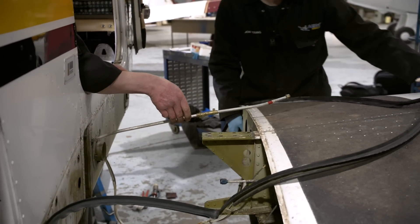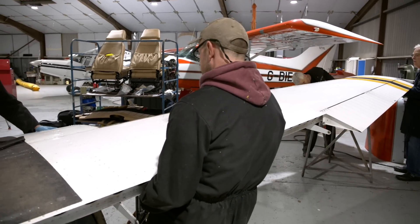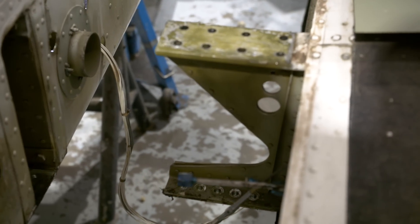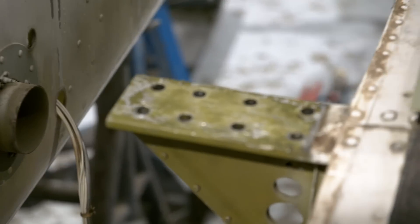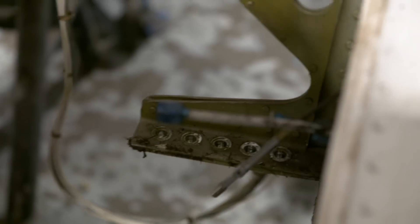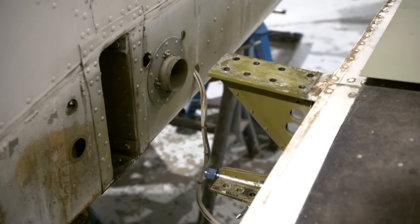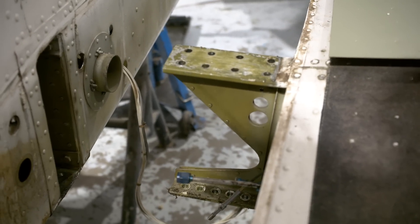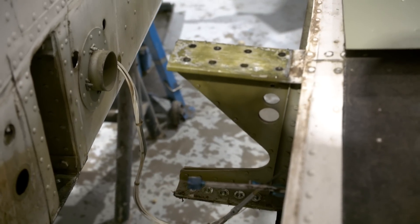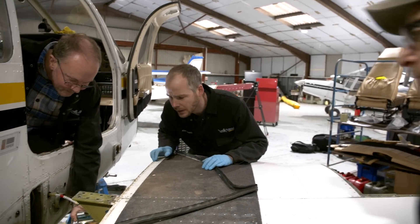They made that look easy. Don't you find it surprising that the wing is only held to the airframe by this small spar? This is all that's connecting the wing to the aeroplane — eight bolts on the top and ten bolts on the bottom. I kind of envisaged that this part of the wing would go in much deeper into the aircraft, but it seems to work — the wings haven't fallen off yet. There have actually been some devastating cases of wing detachments from PA-28s, which is why there's now a mandatory crack check on the wing spar. Both mine will be done later this week.